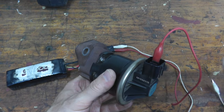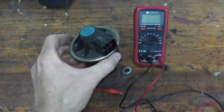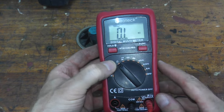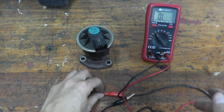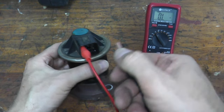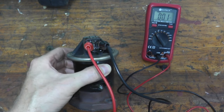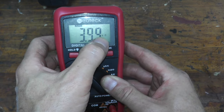There's one more thing we can do. We've cleaned out the carbon, verified that this valve is working correctly, and confirmed it's getting power from the vehicle's computer. But we also need to check the resistance reading. On the multimeter, you want the ohms setting — that's the omega symbol on the meter. A good reading is at least one kilo ohm. Just take the first lead and touch the top left terminal, grab the next lead and watch the meter — we have 1.3 to 1.4 kilo ohms. That is a good reading. Move on to the next one — and now we have 4 kilo ohms. It's kilo because the multimeter is showing the K symbol.